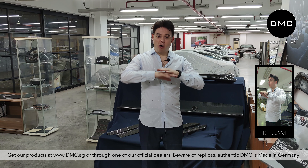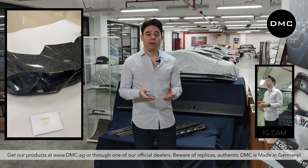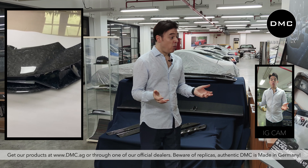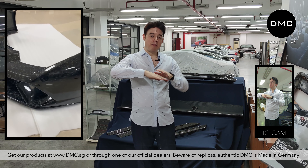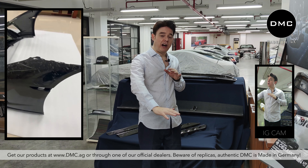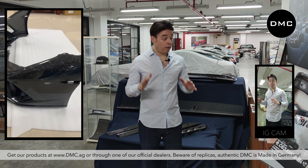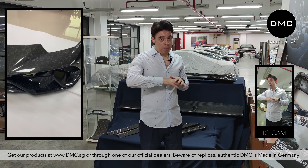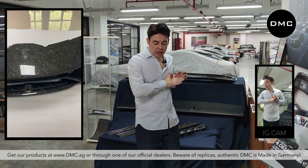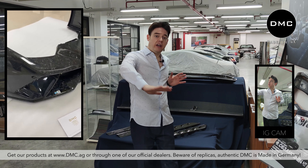They also painted all the surrounding parts. For example, in that case of the Aventador, they also painted the front hood partially and the fenders partially. Consider what I mentioned before about making the paint flow from the car into the carbon — they basically took the opposite approach. What they did is paint the front bumper completely in the new color, and then also paint the old surrounding parts partially so that the new color just applied on the bumper flowed flawlessly into the hood as well.